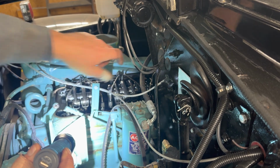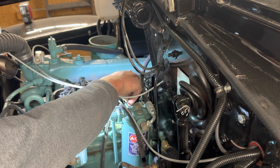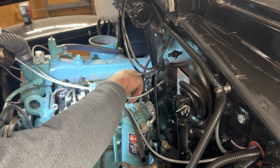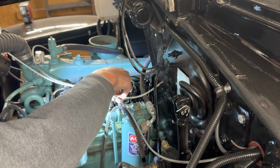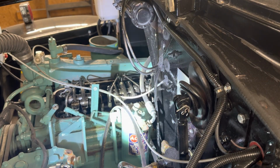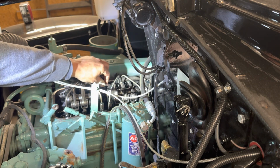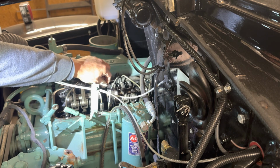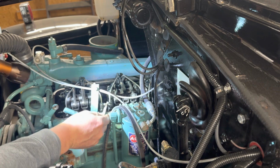So that one's loosened up, and then we'll take our little baby 5/16 here, and now that everything's loose, well, it helps if we actually turn the right one. We're going to do just a couple little 1/8 turns there. And now, with the jam nut off, we're going to check with our 013. Ooh, that's pretty close, guys. Maybe just no, that's about right. Just a tiny bit of drag. It's almost too loose, just barely. I'm going to snug that back up just a hair.